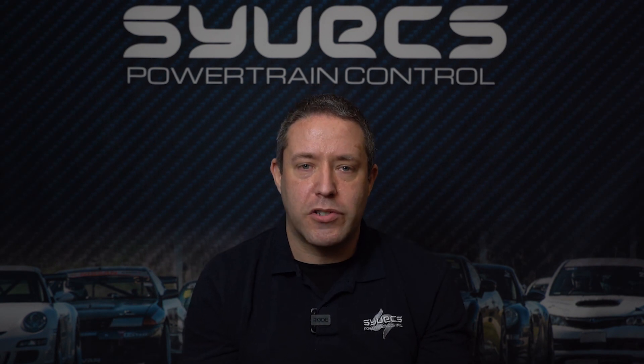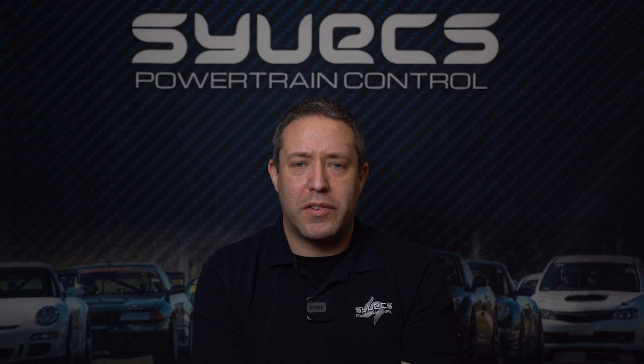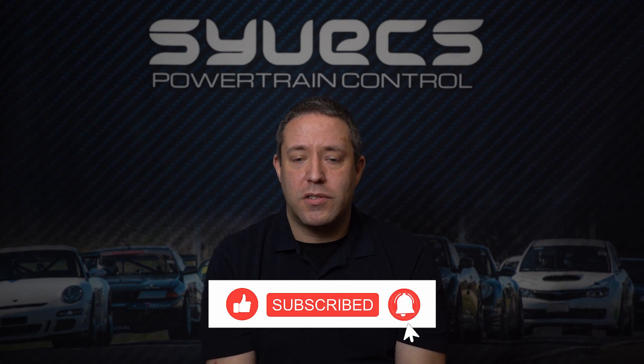One other thing I don't think I've mentioned yet: misfires. If you have an engine suffering a misfire, how do you know what cylinder it is? EGT sensors — straight away you know it's that cylinder and you know where to start looking. You'll see a cool air charge coming out of one cylinder versus the other three, four, five, or six. So this is a quick overview of EGT sensors — why you'd want them, why you really want one per cylinder, what you can do with the information when it's picked up, and how it can take your projects further. If you found this interesting, ask any questions below, like the video, and follow us for more.